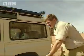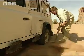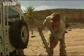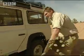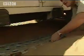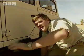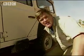So what I'll do is just remove the sand that's impeding the progress of the rear wheels and be out of here real quick. These are sand mats, or sand ladders — whatever you want to call them. They're excellent because they basically give you a road surface to drive on in soft sand. Of course, I don't want to stop too quickly once I get out of the sand, so there's one last trick — I bring these with me.